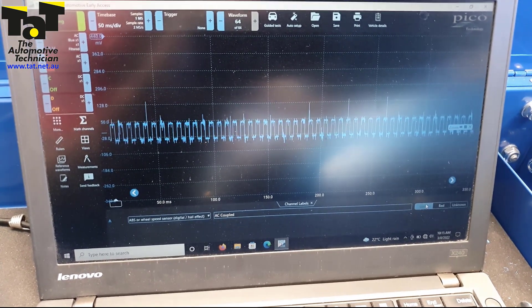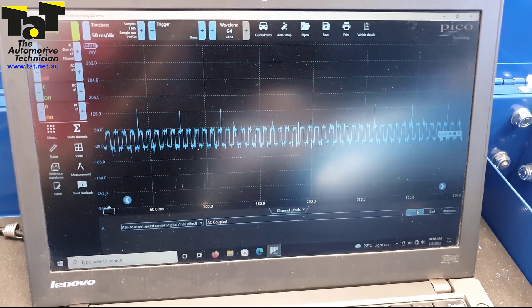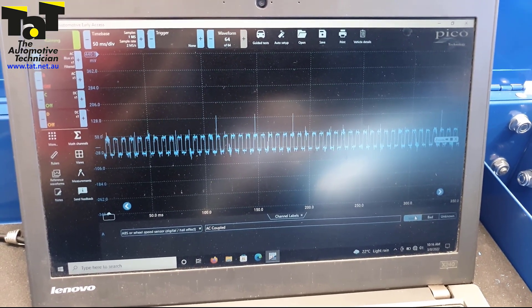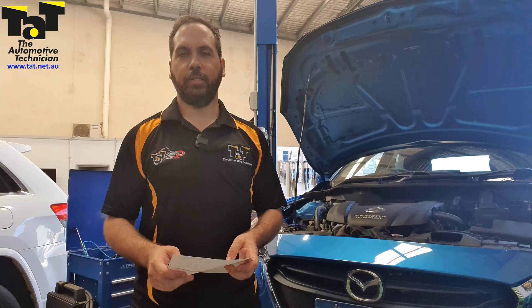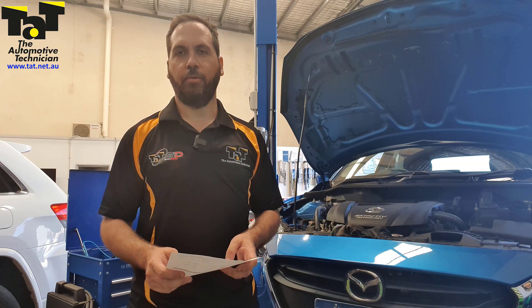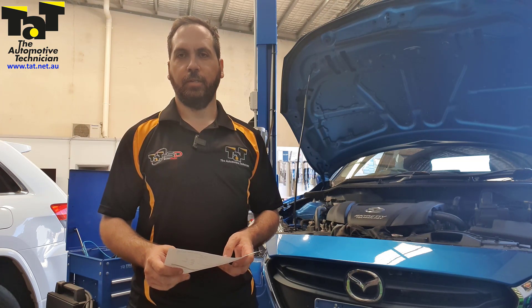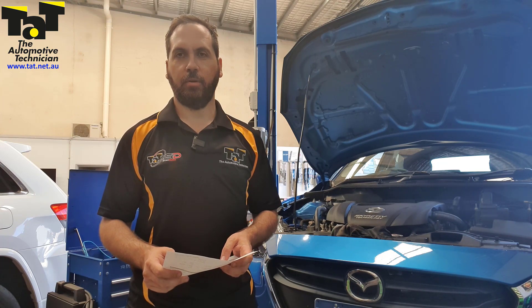So that's all repaired — just a really simple one. It's always a good idea to be making sure we're checking the connector area before we ever replace a component, just in case the component wasn't faulty in the first place, which this one may not have been. Obviously we didn't get a chance to test it beforehand, but now we have and the vehicle is repaired. It just shows the importance of making sure we're checking connectors and wiring before we start replacing components. The last thing we want is to assume the sensor's faulty, sell the customer a wheel speed sensor, fit it and it doesn't fix the problem. Just pay to do our due diligence and 100% rectify the fault. Thanks for watching guys, we'll see you next time.